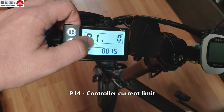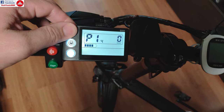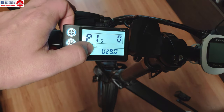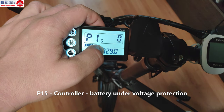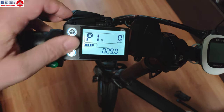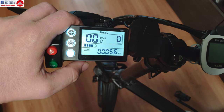P14 is the amp current limit. This doesn't quite work with this controller — the controller has 15 amps; you set 15 amps here. Theoretically you should be able to decrease the power and not go over the maximum power of the controller, which should limit the overall power of the bike. P15 is the low voltage level. You program the controller so that when the battery is at 29 volts it shuts down, to avoid over-discharging the battery — that's the default setting. You can increase that a bit so the bike will stop sooner, showing earlier that the battery is depleted, which should reduce wear on the battery.